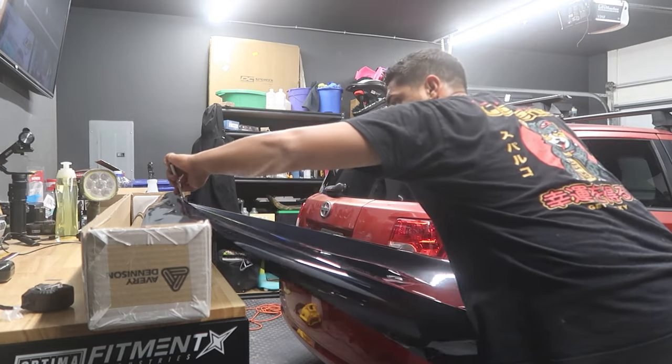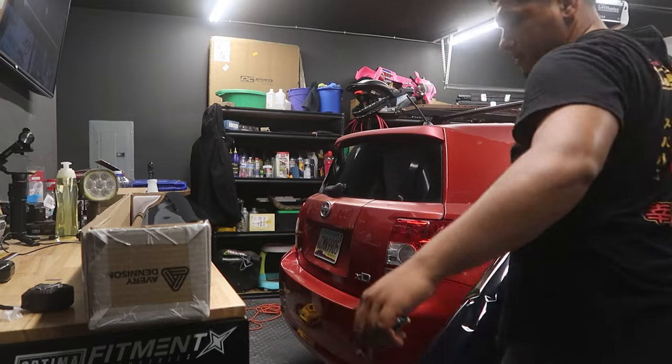I'm a little upset, a little disappointed in myself right now. I did the front windshield — I did it the first time and I messed it up. I did it the second time and cut it a little too short. I did it the third time and everything was going perfect, but when I went to put it on the windshield, the tint crumpled together — and that's not supposed to happen. When I tried to pull it apart, it ripped. I'm going to call Aaron and ask him to come show me his technique for putting on a windshield and how to shrink to the windshield, because the hardest part is shrinking it. If you don't do it right, you can burn it, or if you don't heat it up enough, it's just going to crease.